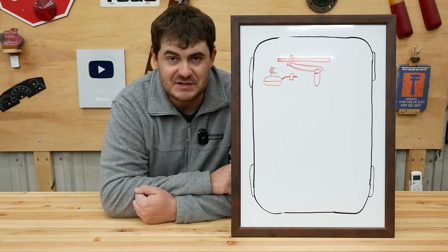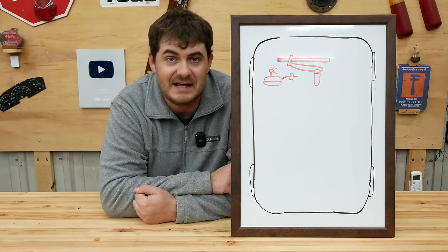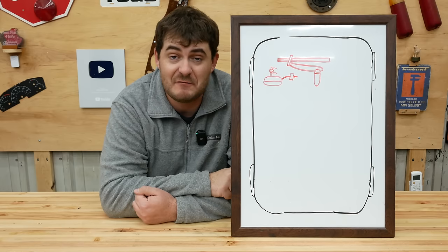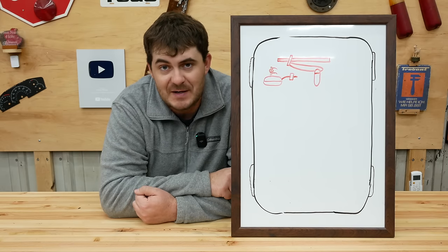Engine stuff. There's currently two things in the Escape that are being engine driven that I need to find a replacement for when I take the engine out. Power steering and power brakes. Power brakes is easy. It's driven by engine vacuum, so I just replace the whole engine with a small 12 volt vacuum pump and a switch.